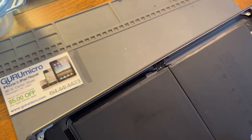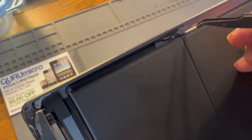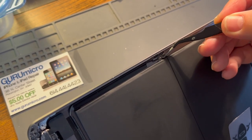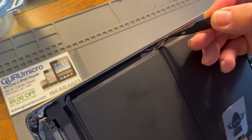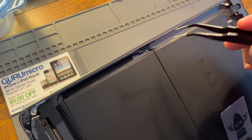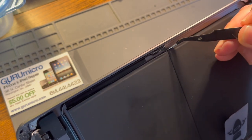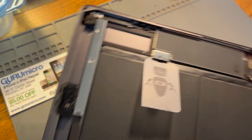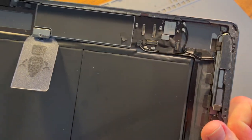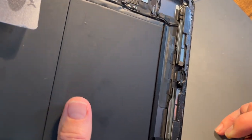Also, use extreme care on this narrow band right here where the battery packs are located. You do not want any tool you're using to poke these batteries. A puncture in this shrink wrap — if you puncture these I replace them. If it's your own iPad and you accidentally poke a hole in it, I have heard people say they have used black electrical tape to patch the hole, but you definitely want to make sure and reseal that. I've seen batteries that were punctured where the device was put back together, and when it comes in again for another issue I'll open it and find where there was a puncture in the battery — it's actually leaking. There is a gas that comes out, and sometimes the batteries will sort of swell up a little bit. When there's a hole in the shrink wrap, that gas leaks out and causes almost like an oxidative corrosion on any metal surfaces around it. So if you do accidentally poke a small hole in one of these batteries, just the outer wrap, make sure to put some tape on it.